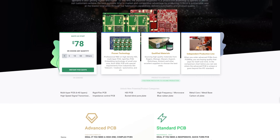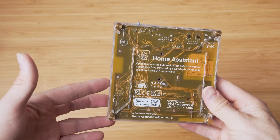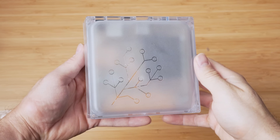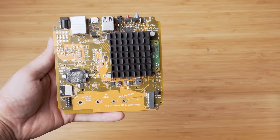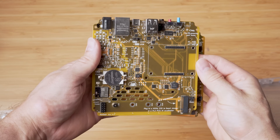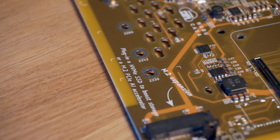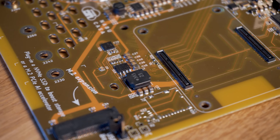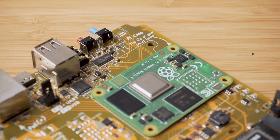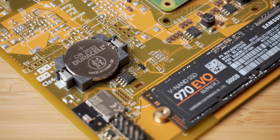Let's open up the Yellow and take a look at the inside. Underneath are four threaded thumbscrews which act as feet for the bottom of the case but also secure the top to the bottom. Once removed you can pull the base unit away to reveal your brand new Home Assistant Yellow. The first thing you will probably notice is either a large black heatsink with the Compute Module 4 underneath, or a large empty space where your Compute Module 4 goes — this is the brains of your Yellow. At the bottom we have the M.2 slot for expandable storage, and over on the left hand bottom corner we have the Zigbee module, which is already connected and installed.